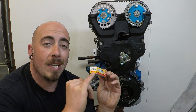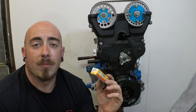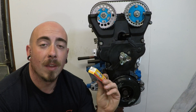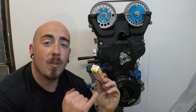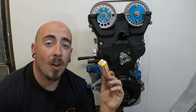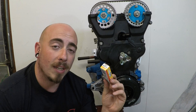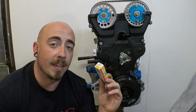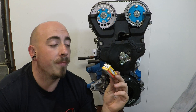The 7 is the heat range of the plug. The heat range isn't how strong the spark is or how warm the spark is — what it actually means is how quickly it can dissipate the heat from the spark plug into the cylinder head. Because I'm going turbocharged, I am going to be increasing the cylinder temperature, so I do want a little bit of that temperature to be dissipated elsewhere rather than staying in the cylinder.